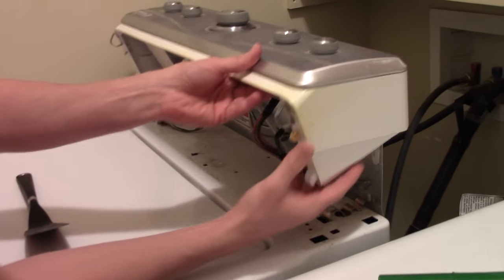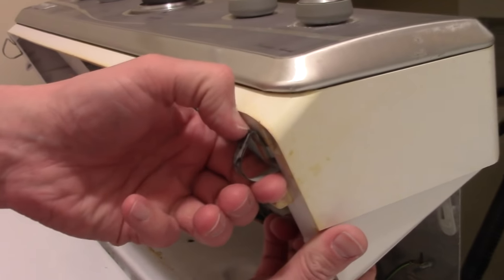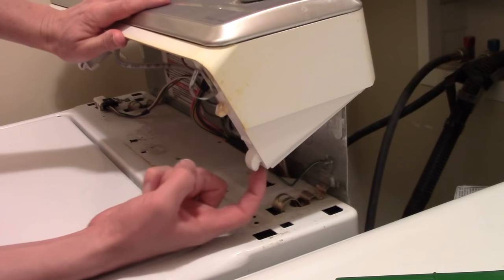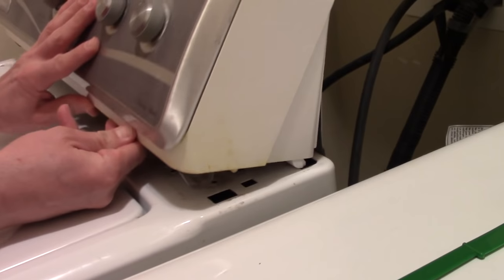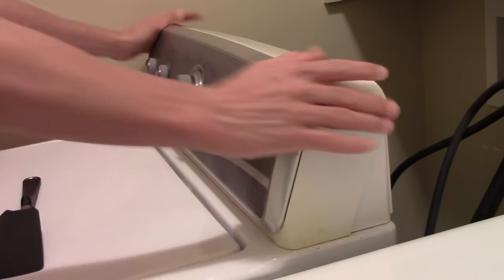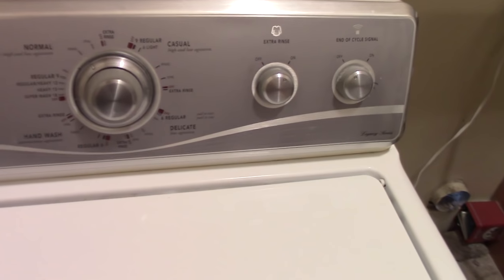You can see the clip is right here. When you shove the spatula in and push, you bend this bit of metal past here and it will allow it to slip out. To put it back in and close it all up, put the plastic hook in first right at the end like that. As long as that's lined up, you just push down on both sides like this and it clicks into place.